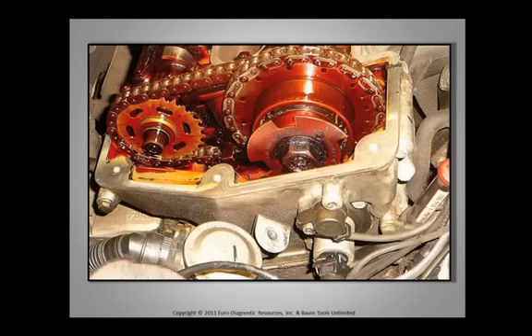Here's an example of a CMP — this is the camshaft position sensor, the proper acronym CMP. It's triggered digitally by the shutter wheel connected to the camshaft snout. This is a very simple example to make things a little more clear for the newer techs, because everybody's got to learn this. Trust me, it's going to get more complicated as we go along.